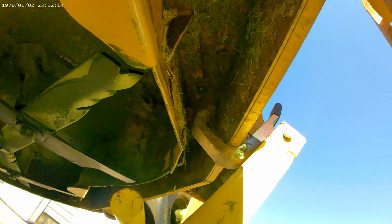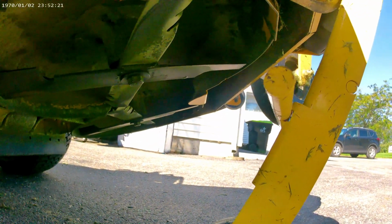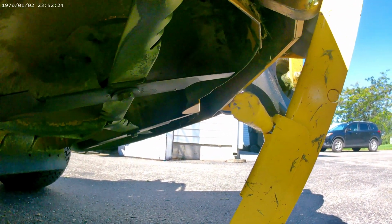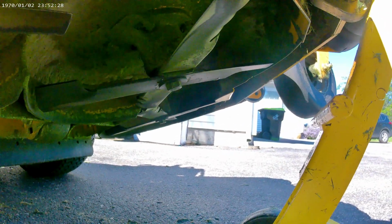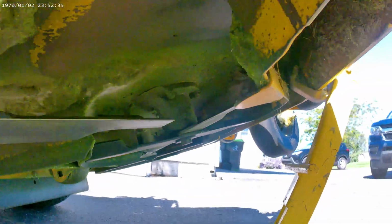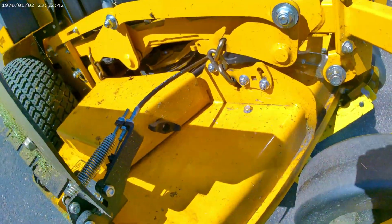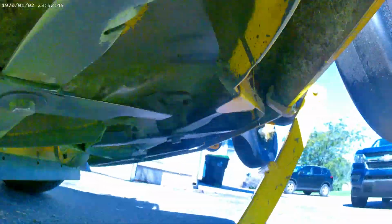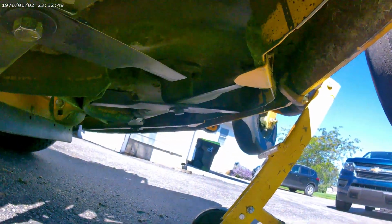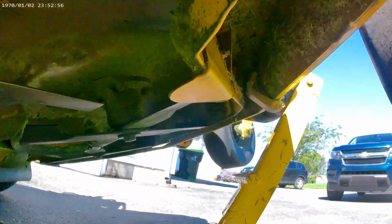But this is the northern grass baffle that Wright Manufacturing sent me. The standard baffle is closer to the front of the deck, and the airflow is not really ideal for these northern lawns like turf type tall fescue, fine fescue. With the standard deck, I think they run these mowers a little bit further south, and they sell these all over the country. So I think Wright Manufacturing realized that they had to restrict airflow more, so they created this northern grass baffle, and everything is just bolt on with this deck. All I had to do was bolt this on, and it really tightens up the airflow, and for the lawns I'm mowing, it has significantly increased cut quality. So if you're mowing in northern Michigan, you definitely need one of these grass baffles.